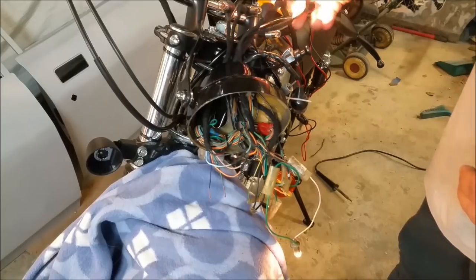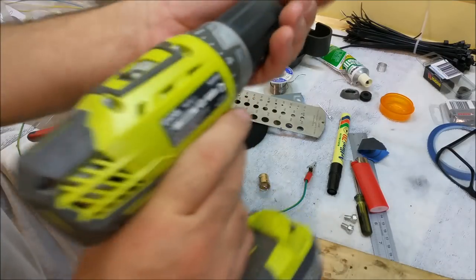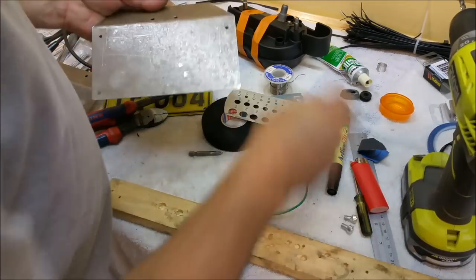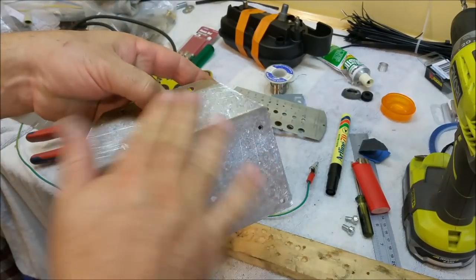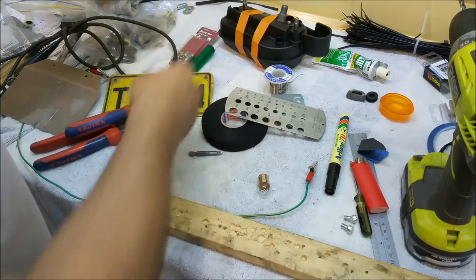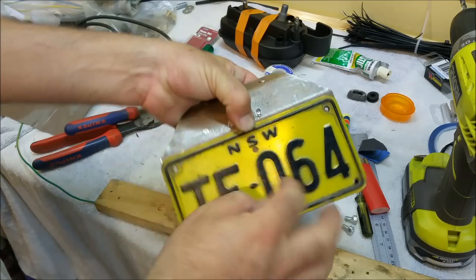With the parkers on we've got all our dash lights there and we've got our front parkers. David's going to sound like Little Red Riding Hood approaching with that horn. I thought I already popped these out to five mil — I'm not sure. We're doing that over here — they just sort of burned over a bit, so we'll hot glue those in once I've painted it, then fudge up the top of them so they don't shoot light straight out but diffuse it a bit. That will light up — and some of it will reflect off the bottom of the mudguard as well, so that should light up quite well.